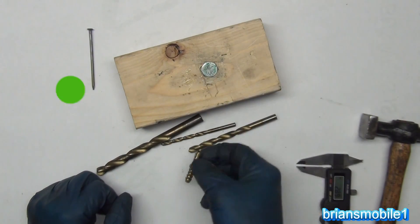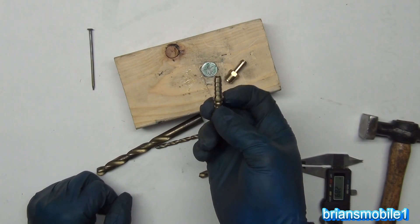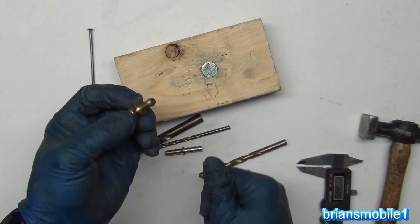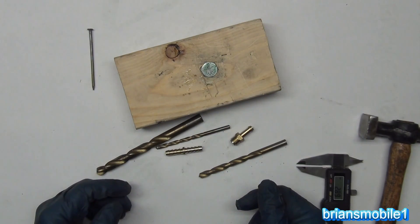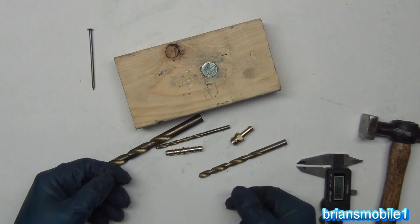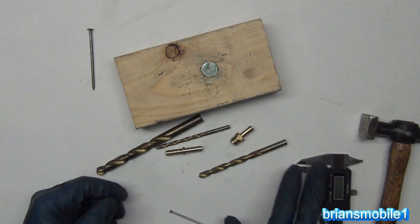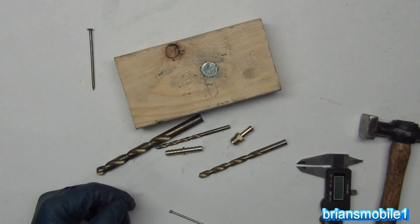This was like seven bucks at Lowe's, this was three bucks at Home Depot — with this you have a risk of stuff falling off, including epoxy to seal it up or silicone. This should thread in and be fine and kosher for a high-side fuel system. If junk gets into your high-side fuel system, you're screwed. Even air will make it not start — you get anything else in there, it can really shrapnel and ruin everything, getting into your injectors and be a real nightmare. So I want to make sure whatever you do, there are no little loose pieces that are going to fall into the system when you're bleeding it.